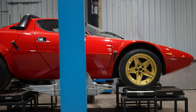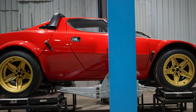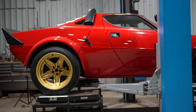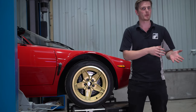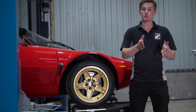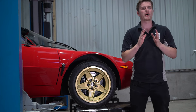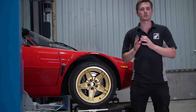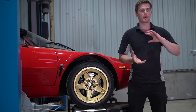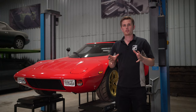There is a bit more to it when we talk about cross weights, which we'll cover on the whiteboard later. The cars we can corner weight need to have height-adjustable suspension. This car has coil overs fitted as standard, and some cars do come out of the factory with it - such as some Porsche GT cars, some Ferraris, some Mercedes AMG GTRs. But on the whole most cars don't have height-adjustable suspension, so it's usually an aftermarket coil over with a height-adjustable spring perch that needs to be fitted.